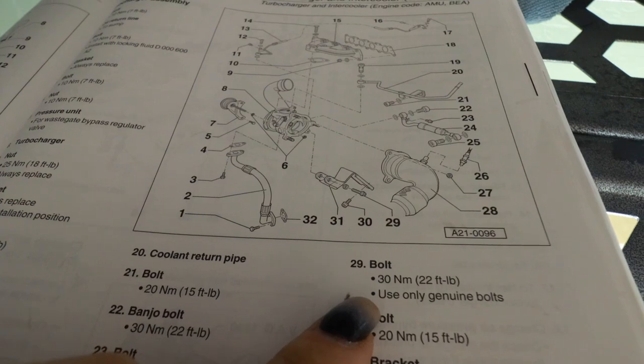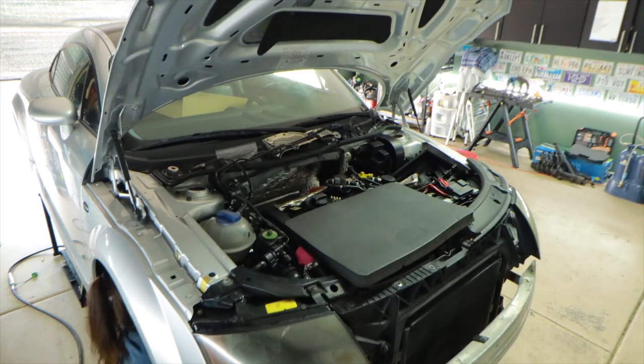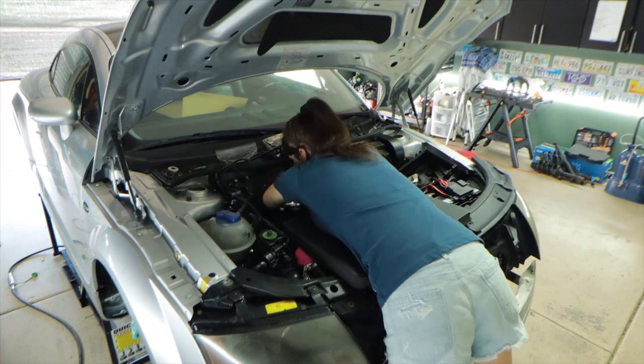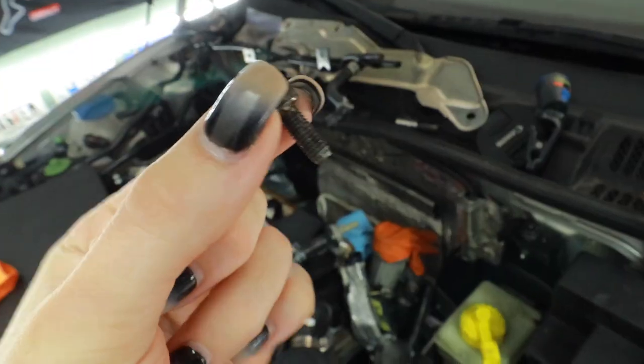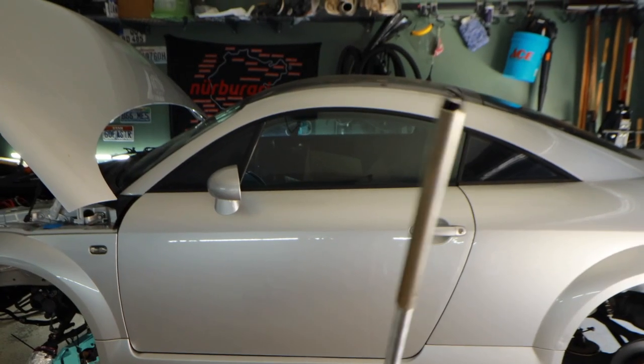I don't know what the correct bolt for that hole is because the bolt that was in there before was the wrong bolt, and it says in the tech data to use only genuine hardware — use only genuine bolts. I tried tackling it from up top for a little while and that was not working out too well. So I went through the wheel well and stuck a long punch into a hole below the turbo, which allowed me to pry up ever so gently. Then I used my right hand to thread the bolt into a captive nut. Next is an even more difficult bolt — this little tiny cap head allen screw. I have this little graboid tool — I'm going to use it to hold the bolt down inside that crevasse, and then I can slide in an extended allen driver and tighten it down.